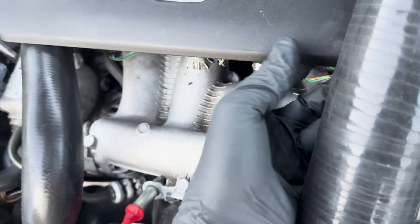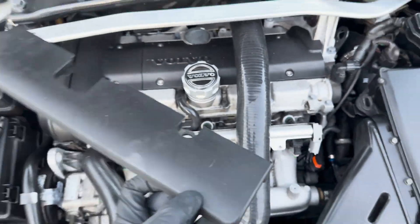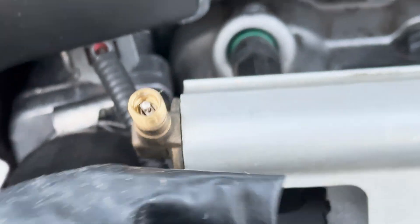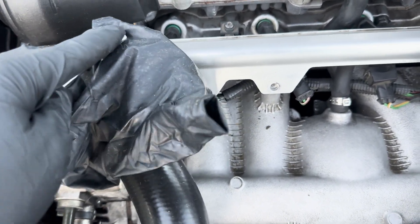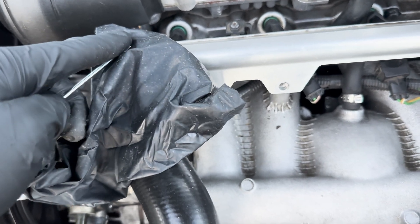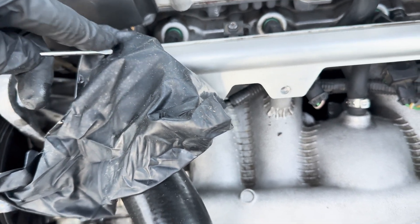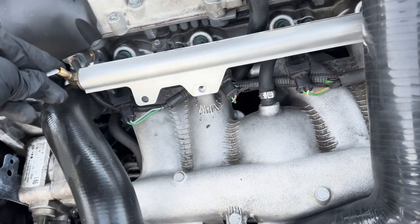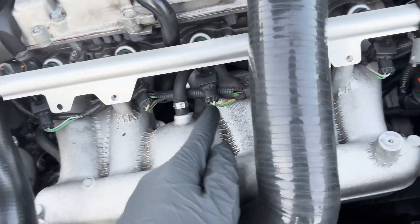Getting the plastic cover out shouldn't be very hard, especially if you've removed your charge pipe. Now for the dirty work - get yourself a rag. Get a little flathead or something that will fit in here and press that little pressure release valve. Some fuel will most likely squirt out, but it's better from here than when you release the return fuel line and have it spray all over your engine. It's better to absorb it with a rag and release it there first - sometimes nothing will even come out.